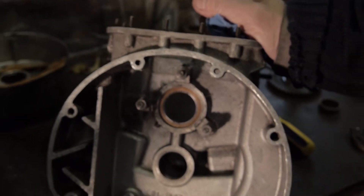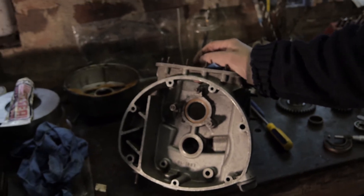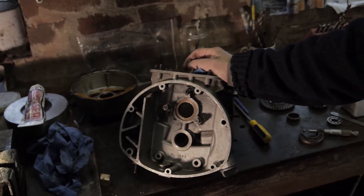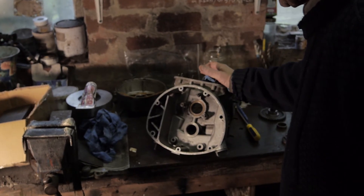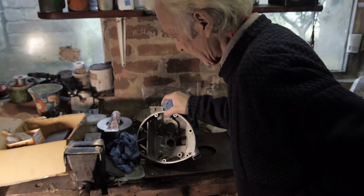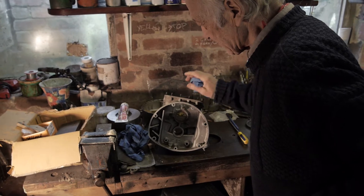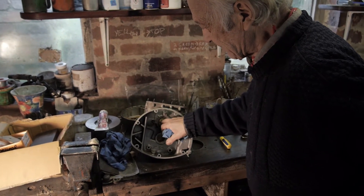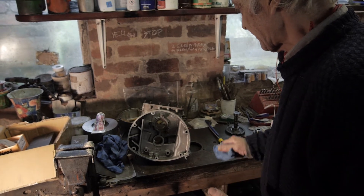That will usually lead fairly quickly to a total big end failure. I've seen many, many of these bikes with the rear big end bearing worn out prematurely. I've seen many LE Mark 3s and they've all got a dull big end, and in most of them it is this rear main bearing — fed by this here — that is the cause.